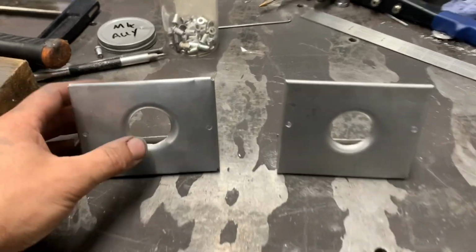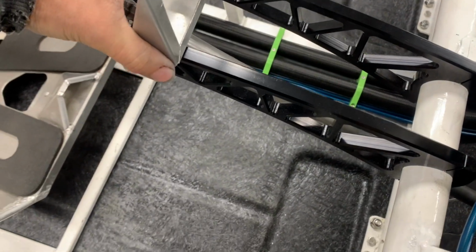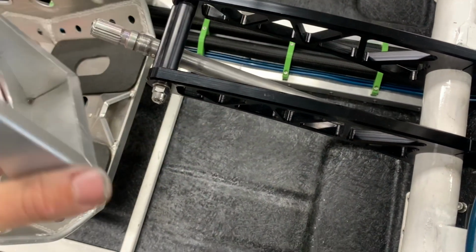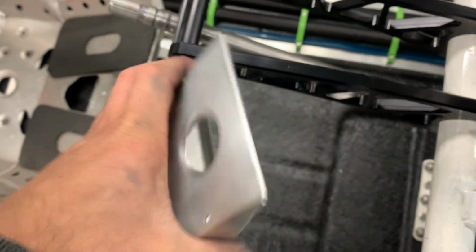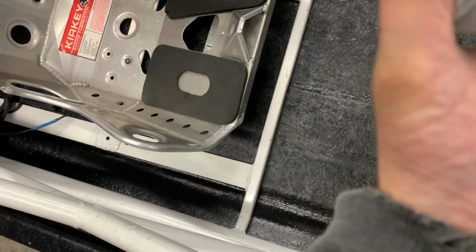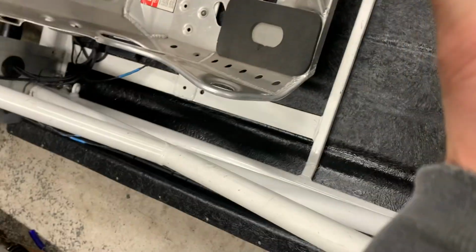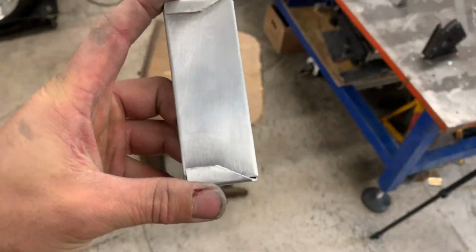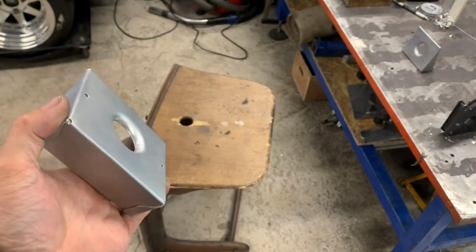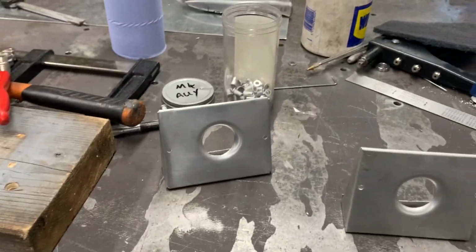So now what we've got to do is make a back for it, and it's got to get fitted to there. So what I've got to do is basically drill through that, find out the centre to the centre, compress, put the back on this so I know it's in the right place. Then drill, basically, this is really tricky with one hand, isn't it? So I'm going to make a back, put it on, and then drill, same distance apart, screw it on. You'll only have a couple of M4s, it won't need something major.